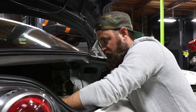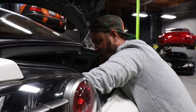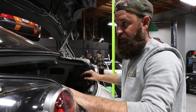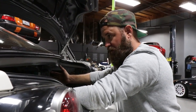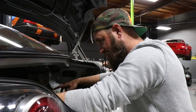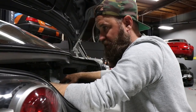Now we can start figuring out how we want to mount this tank. Where it sits front to back in the trunk matters — with this car, the struts mount right where I want to put the tank. If we ever have to service the struts, the tank would have to come out, which is a pain. So I might want to offset the tank a little further forward to create clearance to reach the struts and all the bolts that fasten them.